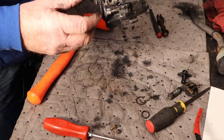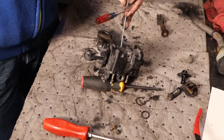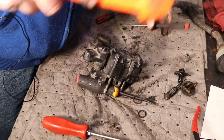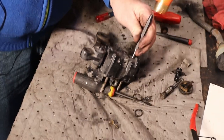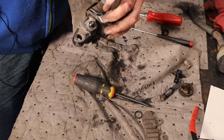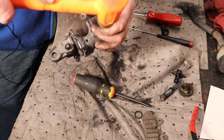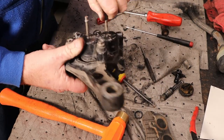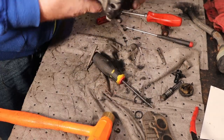I've had cases where those are super duper stuck. Let's set a screwdriver underneath there and go ahead and give those the old tappy again. I'd hate to actually go get a punch, but I guess I might — I think this one will be sufficient. One brake pad. I want to go ahead and tap those on out of there. There is the inner brake pad, or the outer, depending on how you look at it. Get these pins out of here — we'll want to give them a coating before they go back in.